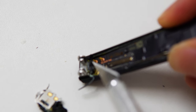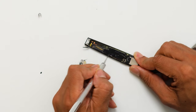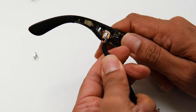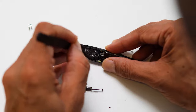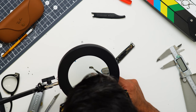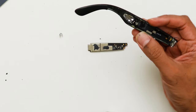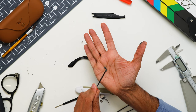On the mainboard there are also pogo pins connecting the camera module to the mainboard. There are some small foam pads on the shielding can that ensure they do not come off when dropped. There's a dedicated cavity in the arm for the speaker module, and there's also a speaker membrane that sits inside the cavity. Here is another part to the speaker connected to what looks like it supports the spatial audio, or it could be a sensor. The mainboard is screwed onto the frame and has two shielding cans and some other discrete components.